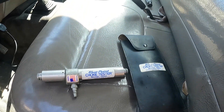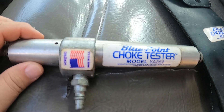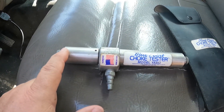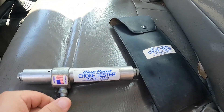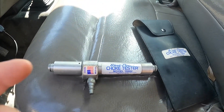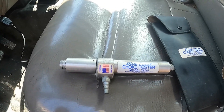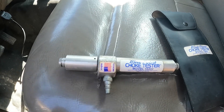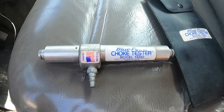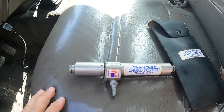The way I found how to spot this particular problem - and I'll tell you what that is in a bit - is using this choke tester. You hook shop air to it and it blows really cold air out of one side and really warm air out the other. What I'm suspecting is the coil on the IPR, right where the plug goes in. When it gets to temperature it breaks down and it's no longer operating as an electrical magnet. The computer is asking for movement but the magnet can't produce it - it's a temperature breakdown on the coil.